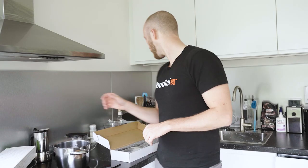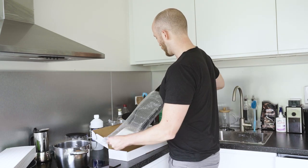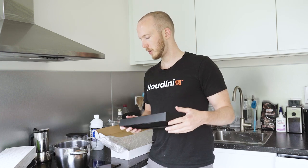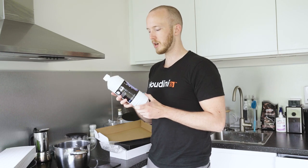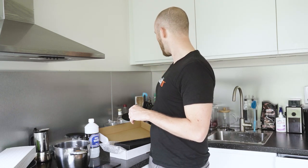I'm warming up some distilled water here because I'm going to be pre-flushing my radiator. It's my first time doing water cooling, but I read all over the place that pre-flushing is probably a good idea because there might be some gunk left over from the factory, and if that gets in your water cooling loop it can cause issues long term. I'm going to swish it around with some warm water — not boiling — using distilled water, because regular water might lead to growth in your system. I'm also adding a little bit of vinegar just to help clean it, and I'll rinse it a couple of times.